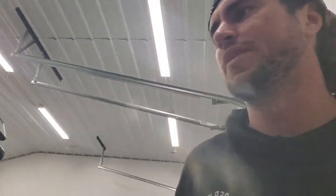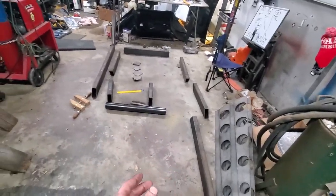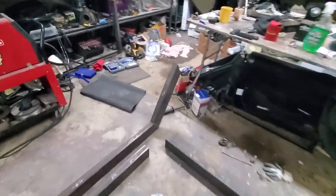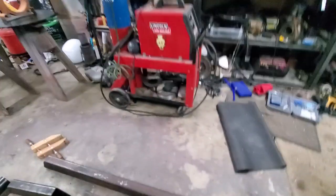I did start on the Model A motor - I decided which motors I'm going to use. I'm actually doing two motors. Here's my frame. I started to weld it up but it's really thick steel. My welder is 110V and I need a 220V. I need to bevel the edges and make my welds thicker because they're coming off and it's not good.